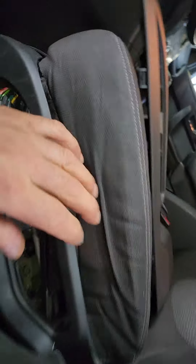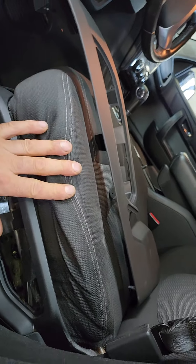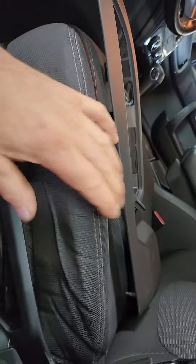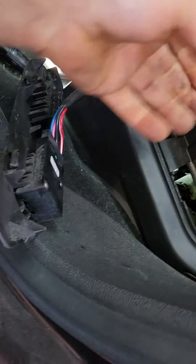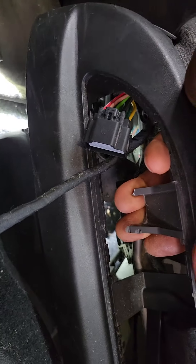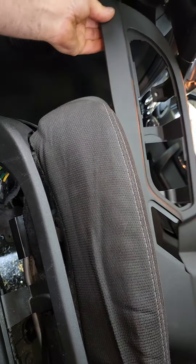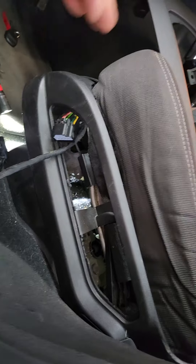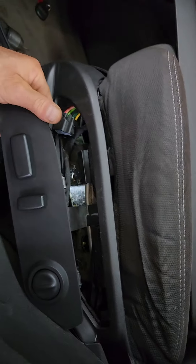Here's what happens with the broken seat frame: the foam starts to decay in the seat — it's not really meant to last forever. You keep getting in and out of it, and eventually it breaks the mounting tabs. This one's broken here — so this is what the new one looks like. That tab breaks, that tab breaks, it breaks in the back, and then it breaks more and more. It usually winds up breaking the switch if the switch isn't already bad.